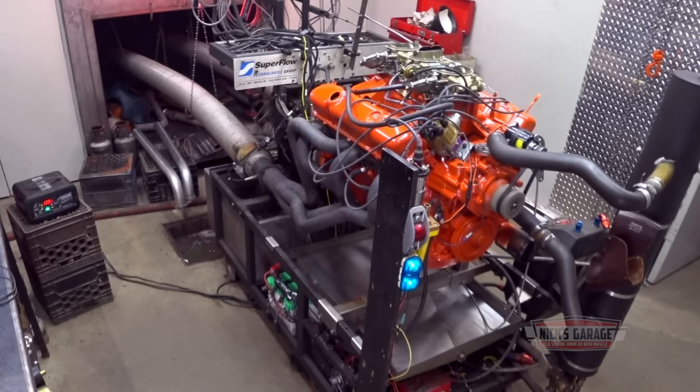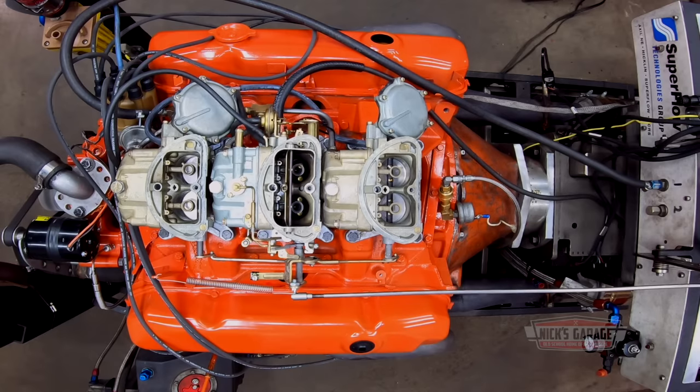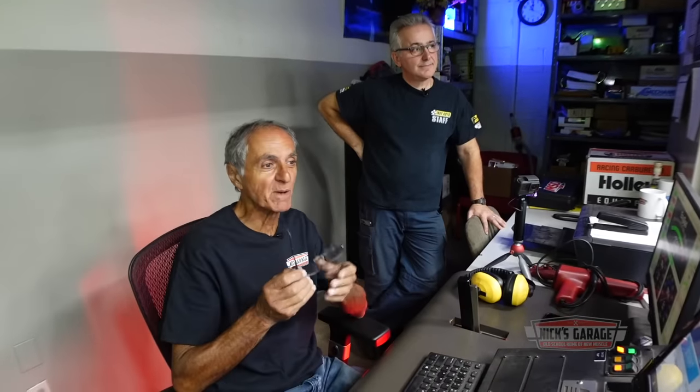One thing I love about the dyno is when I get a six pack, I just love it. It's not very often we get six packs, but I think we've got more six packs in this dyno than any dyno room that I know of. We've done a lot of six packs here. Except maybe Chrysler. And this is not common for me: a 383 with a 440 crank, which equals a 426 cubic inch. Something new to me, let me tell you.